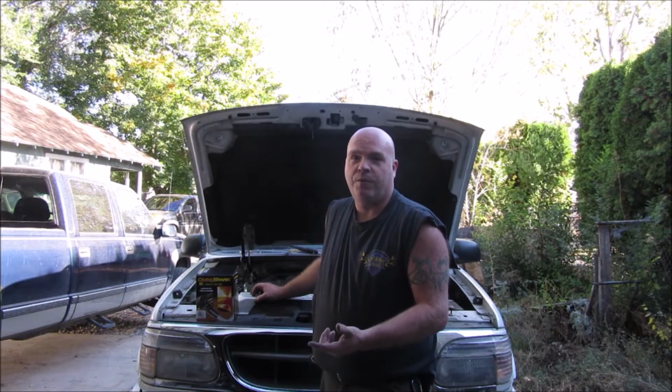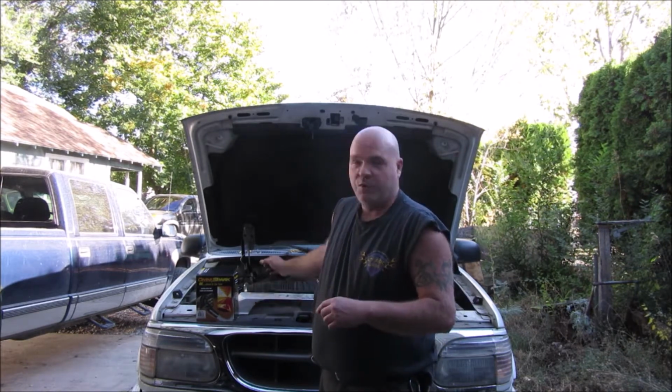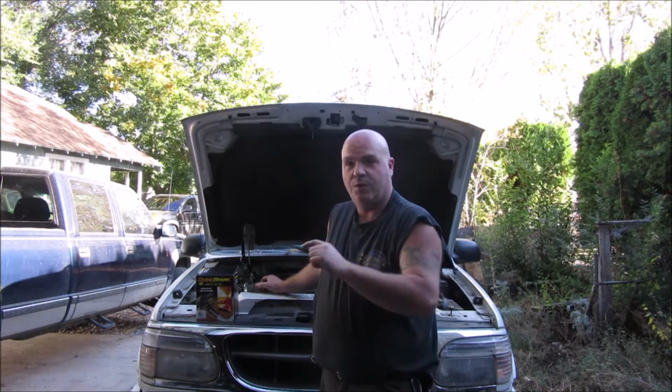Unfortunately, O'Reilly's gave me the mail truck ones, and if you watch that video, you'll see that I not only started out with only 5 spark plug wires, and as I was going, ended up having to go back and get different wires because the wires just weren't matching up. So anyways, it was a nightmare. Well, the ones for the mail truck, for some reason, have a shorter piece that goes into the coil, so the spark was having to jump a lot further to try and get it in there. All in all, the rest of it's exactly the same, but that little piece on the end, the ones on this one are quite a bit longer. So that was my problem.